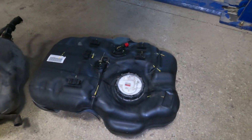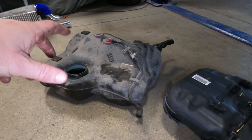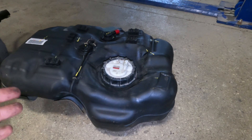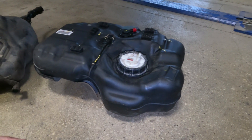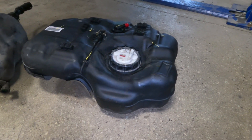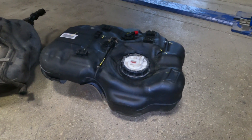What is super cool about this is the fuel sending unit installed in the gas tank is actually the one out of the original RSX gas tank. I was able to easily remove it from the RSX gas tank and put it into this gas tank with no modifications whatsoever. What that means is we can use this fuel sending unit and keep the fuel gas gauge on the original cluster happy, so we'll know how much gas we have — which is really nice for a car that you want to drive on the street. For a race car it doesn't really matter, so not a big deal.